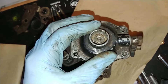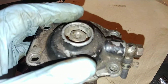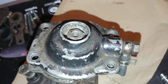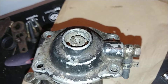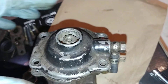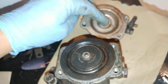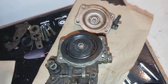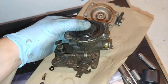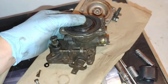The smoke screw is just a Torx bit with a lock nut on top. This one has already been basically fully adjusted all the way in. I just don't drive like an idiot — ease your foot into the throttle, don't just mash it to the floor every time, otherwise that's going to make your truck a lot smokier driving around town. Pull off four screws and you can see inside why adjusting that screw makes a difference: it pre-tensions this mechanism to start off a little bit lower.